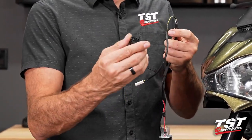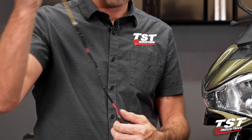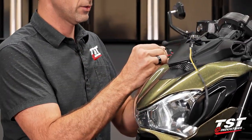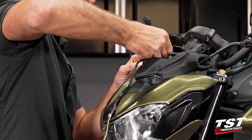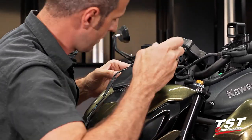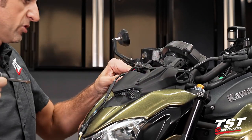This ratcheting clip fastens the signal to the bike from the inside. Let the teeth go on first — it does have receiving teeth on the body of the signal. Now we can pass this through the well to the inside. The clip can go sideways to get inside, and as the signal gets inserted, we can go ahead and ratchet that on. I'm going to use a flathead screwdriver to drive it on and preload it. The ratcheting clip has spring-loaded feet, so you need to engage it in a way that preloads this connection to make it stay in place.